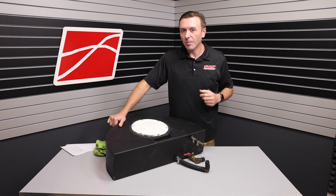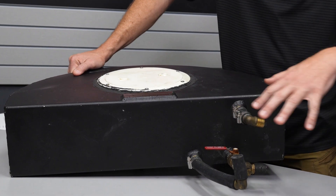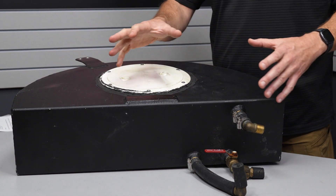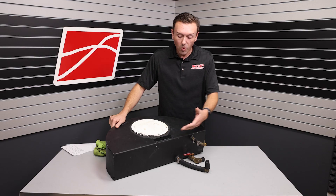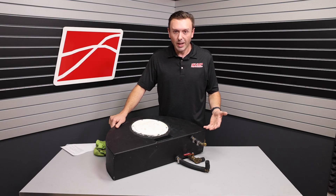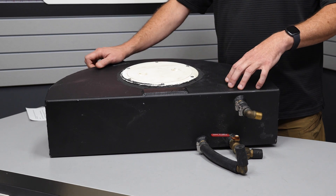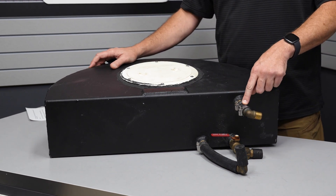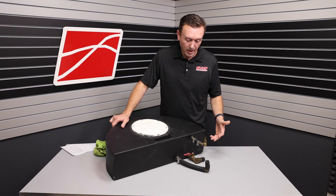These are the first things that come to mind having crewed a very fast car at the track. Everything's over on this side, so you're going to have to hope that your trunk setup with your pump, wiring, and everything is going to work over here. There's no way to mount the actual pump, which is going to be really crucial to the function of your ice tank. When you go to this type of scenario, you usually go to a big aftermarket pump — sometimes three-quarter inch lines, sometimes all the way up to one inch — and I don't see any provisions or options for that here.